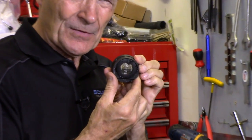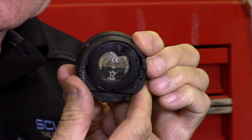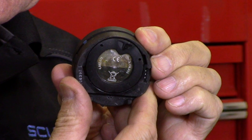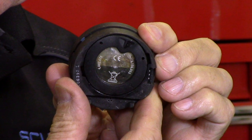Can you zoom in there, Kevin? Look in the back of this. First of all, you can see on the inside — can you see that bit of rust? Bad news. That little bit of rust is the battery starting to corrode with the contacts. It happens almost instantly with salt water. You've got to get that battery out of there. Very, very important. We're down to 20% now.